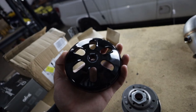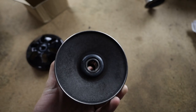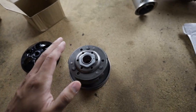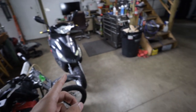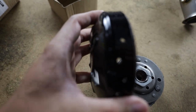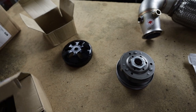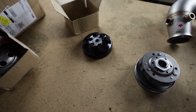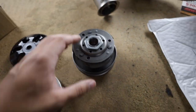This clutch bell is from our favorite brand, Glixel. It's a stock clutch, so it's got all the stock clutch springs in it, so I'll have to take it apart and put the clutch springs in it that we have in the scooter right now. The main deal with this is it is vented — they have a little scoop to them on the outside like that. Considering the scooter has 6,000 miles on it, I figure why not change the clutch? It's probably time.